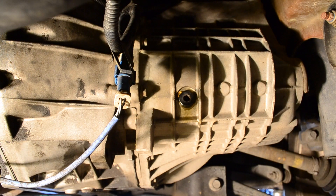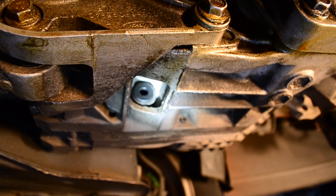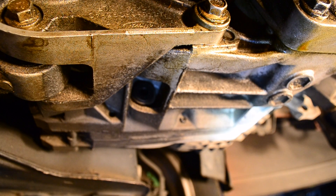Now that the fill plug is loose, we'll move on to the back to make sure everything else can come loose. Here's the location of the drain plug — it's just off to the left of the oil pan in the middle of the transmission. It's in a dark area so I'm using a flashlight. The drain plug is right here, and the fill plug — follow my flashlight — is right up front around there.